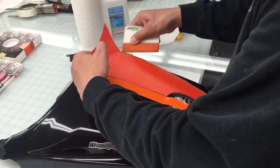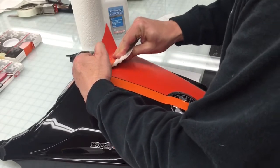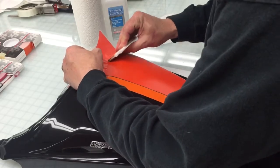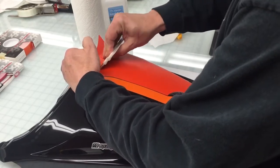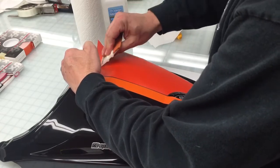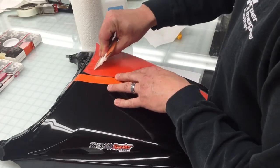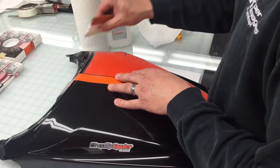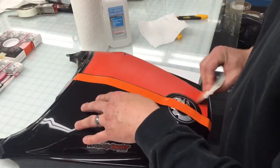You've got to go up over the ridge, working the film again from the center to the outsides. If you have to, you can pick the graphic back up to reposition and keep squeegeeing. We have a transfer tape on here, so it does act a little bit as a limiter to allowing the graphic to lay down. If you wanted to, you could eliminate the transfer tape at this point and work with the raw film, but I can see that this will lay out. So just keep squeegeeing from the center to the outsides.